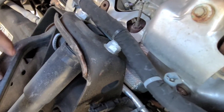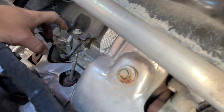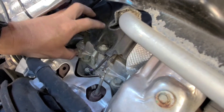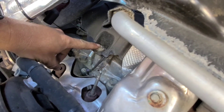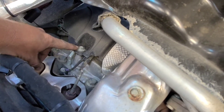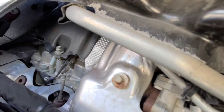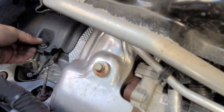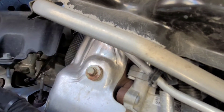Here's the A-frame right here. You can go right up in on the engine and you see this bolt right here — we're going to take that out. I want to say it's a 10 millimeter. That connector right there is what we're going for, but we've got to get this plastic piece out of the way to get to it. I think it's just this one bolt, but there may be another on top. I came in and took this 10 millimeter bolt out, and then you kind of got to lift and wiggle and pull, and this plastic cover will come right out.